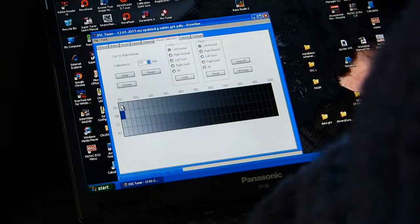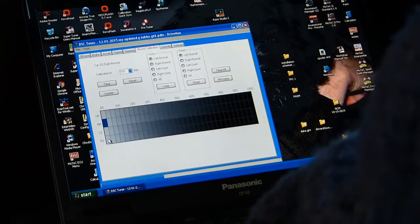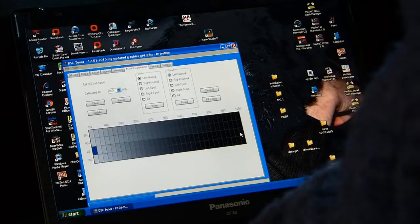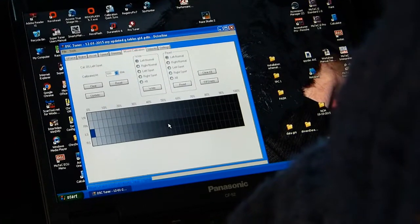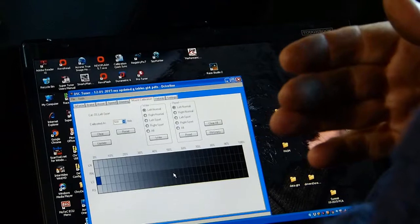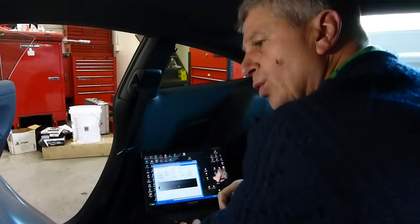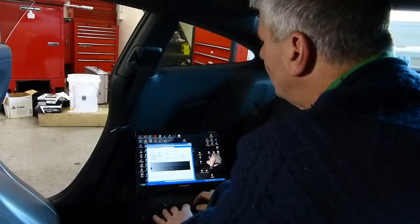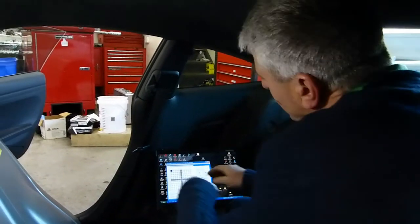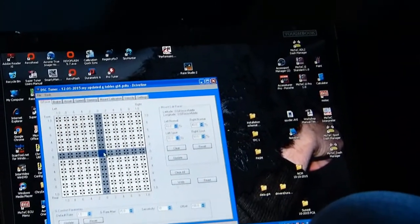You can see we have a left motor mount and right motor mount in normal mode, and then both left and right in sport mode. These have two completely different calibration tables. It depends on how early the motor mount will start to lock up, and what this really changes is — if you've driven the car — it changes the way the engine suspends, causing early entry oversteer into a corner or in transitions from right to left. In the factory car, the center of the G-table is full soft, so when making a right-to-left transition, you always go through the hole in the middle and the engine rocks. Ours does not — the G-table is completely filled with values.